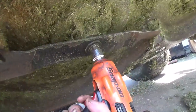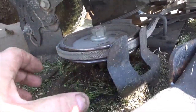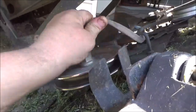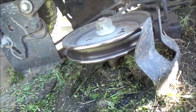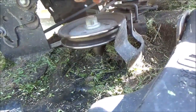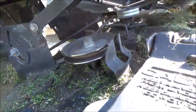First thing we're going to do is remove the blade. This particular machine is a 7/8ths. Obviously this one's missing a belt guard — I'm going to replace it when I go on with the new spindle. Go ahead and remove the belt; it's just a hand deal there. I think this is the one that was making the most noise. Yeah, those bearings are shot. See if we can see up underneath. Yep, it wasn't going to live very much longer.